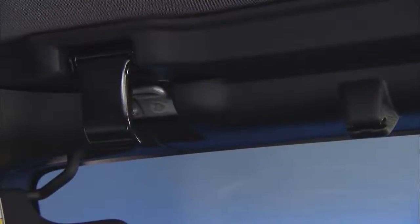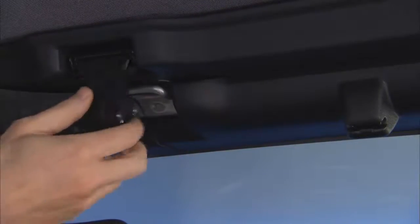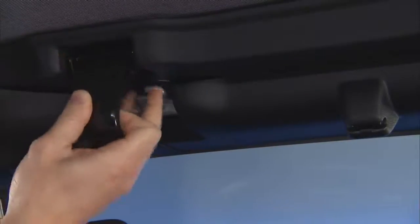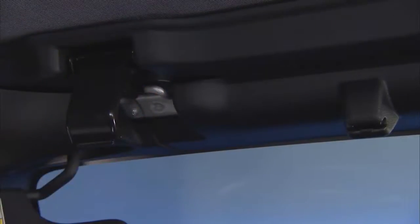Moving inside the vehicle, unclip the sun visors and move them out of the way. Then flip the top latch hooks down from the handles and insert them into the windshield slots, but don't close the latches completely yet. That will create too much tension to easily reinstall the quarter windows and rear window.